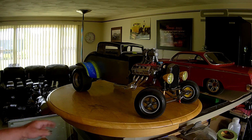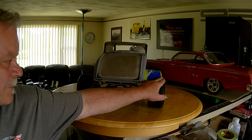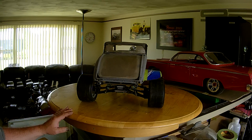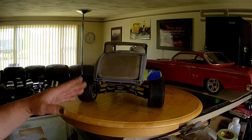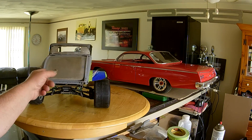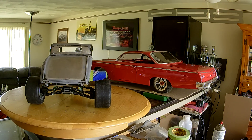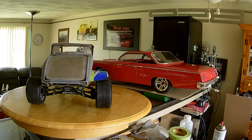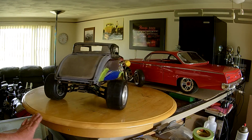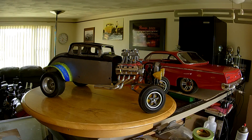I'm going to continue making my templates and go from there. I've got one side done — I'm scalloping the fenders, and I'll do the same to the other side. I'll make an exact copy and reverse it — that's how simple it is. One template works for both sides. That's how I built the Impala too — I drew all the passenger side panels on flat poster board, folded and cut it, laid it over sheet metal, and cut it out. Anyways, guys, I'm going to sign off. I'll catch you later, adios.